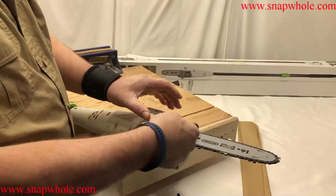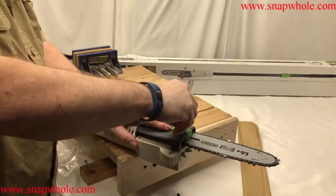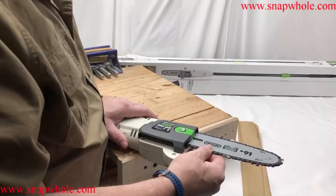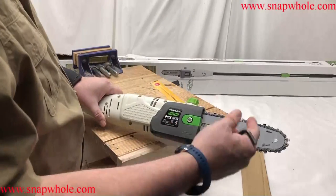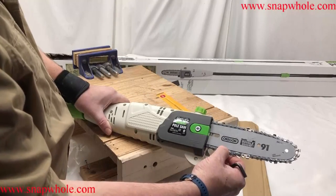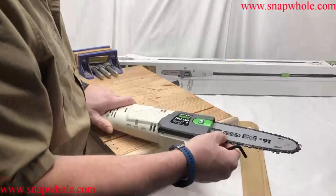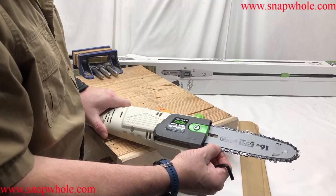This piece has tabs here and back here, and they go in — that one doesn't go down until you tighten it up, which is a bit strange. I think I like it a little looser; if it's too tight it might damage the chain. The manual says chain tension should be two to four millimeters, and it is two to four, but I still think it's just a tiny bit tight so I'm going to loosen it a little.